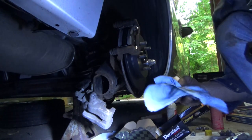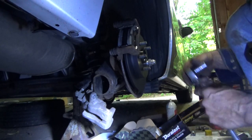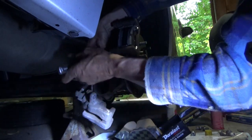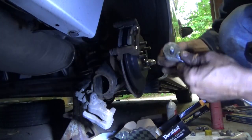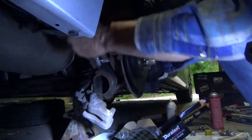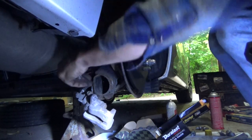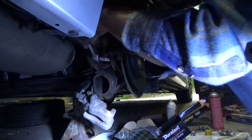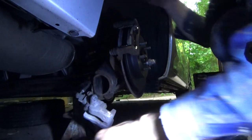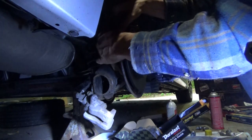Oh, hey, these brake pads, they're new. Okay, now we got that all in. Let's get these tightened down. And then we get to do the fun part with backing off the piston and the caliper. And make sure those are real tight. Pads are in and they move.